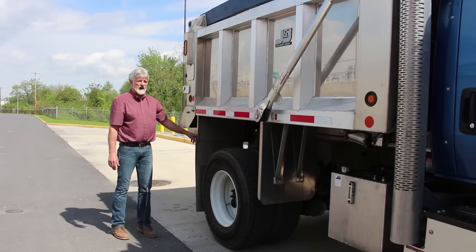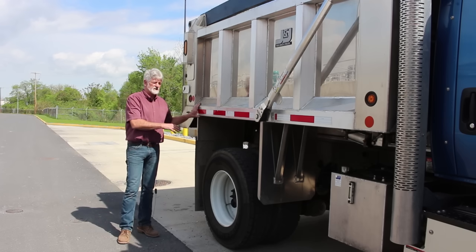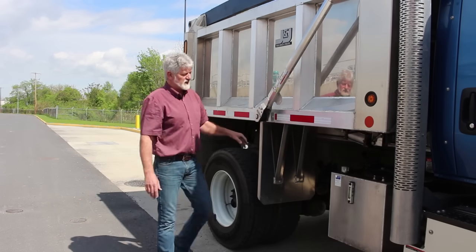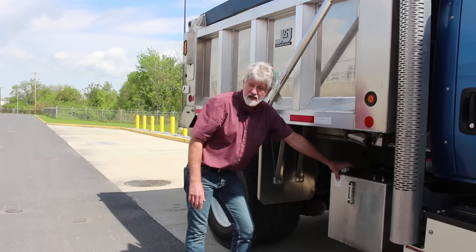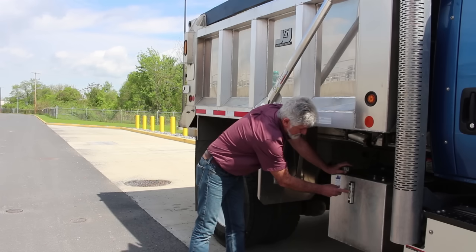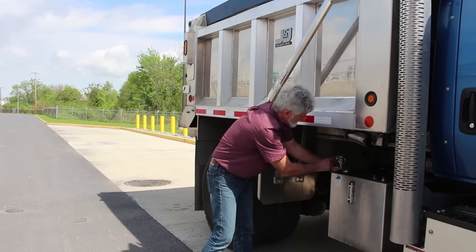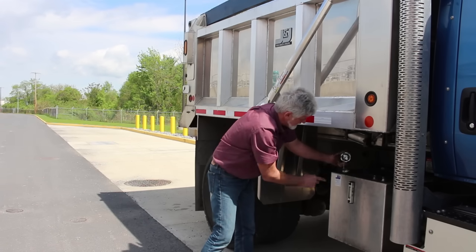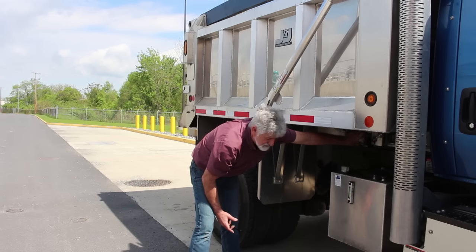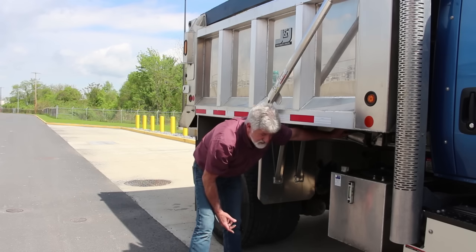We will now finish the passenger side of the truck. On the passenger side, I would inspect the same items as the driver's side, with a few differences. The first difference is the hydraulic oil storage tank — securely mounted, not cracked, bent, or broken — with hydraulic oil above add and below full, within operating conditions. I see no signs of hydraulic leaks. I would inspect the cap to make sure it is not leaking and the safety chain is intact. I also have the tailgate air release for the tailgate — it is air operated, securely mounted, not bent, cracked, or broken — with air lines connected and no audible leaks.